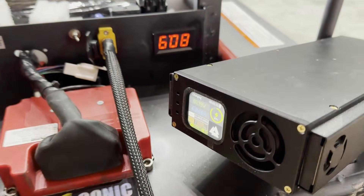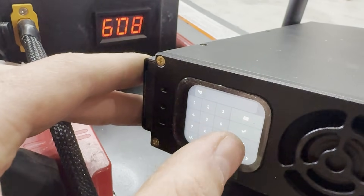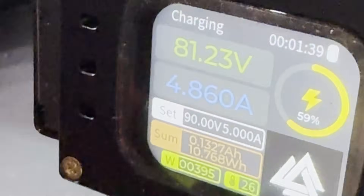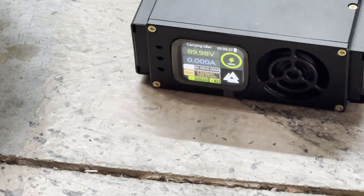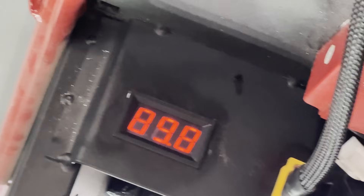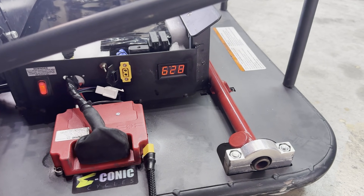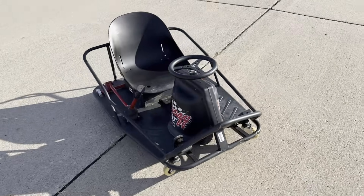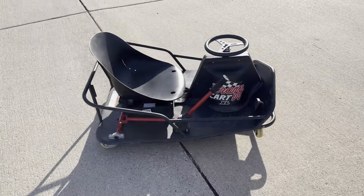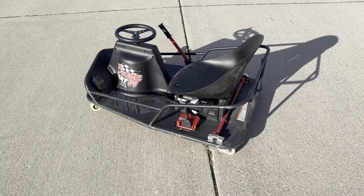Before really riding hard, I tested the overcharge protection by setting my charger to 90 volts. If the BMS is working right, it should stop charging before going over 84 volts. I sat and watched it to make sure it didn't actually charge at 90 volts and blow up. It looks like it cut out — when I unplugged the charger it dropped back to 83 volts, so I know the overcharge protection is working. This test also proves the MOSFETs didn't fail on, which could have happened when I was pulling a ton of current earlier.